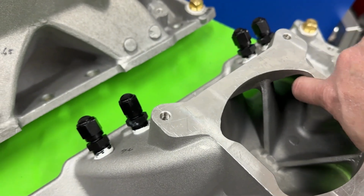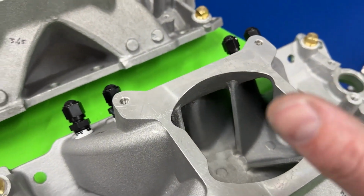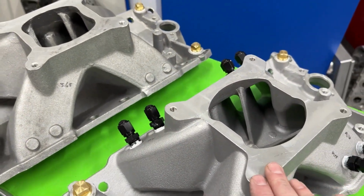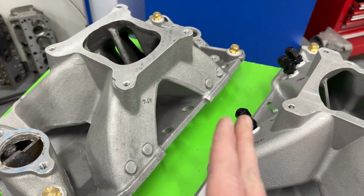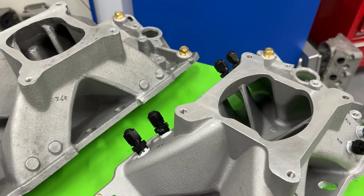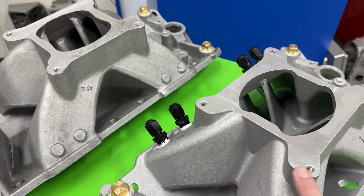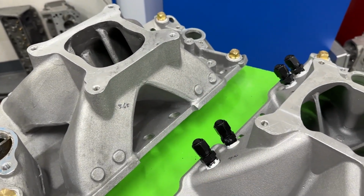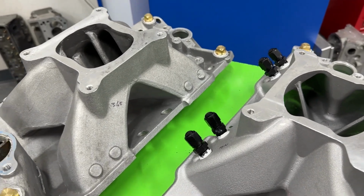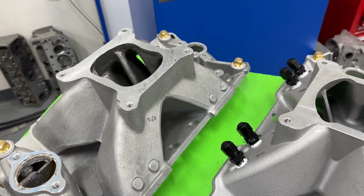The outside runner looks really good. Nice line of sight that. So, but it's different. Of the 3 manifolds, this one finished worse. Version 1 and version 2, even though that one was a bad port match, were really close to the same. This one finished 3rd overall out of the 12 manifolds tested, but it was still quite a ways from what those other two were, especially that one. So something to think about. But anyway, let's go ahead and look at the data. Let's look at the overlays and also the hard data.